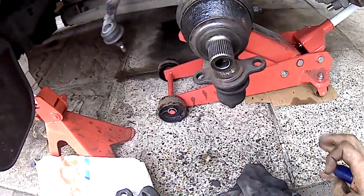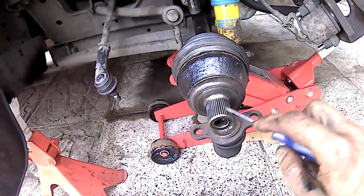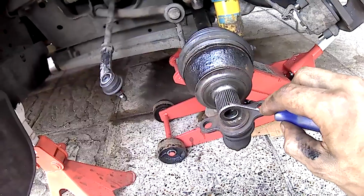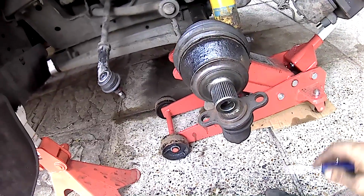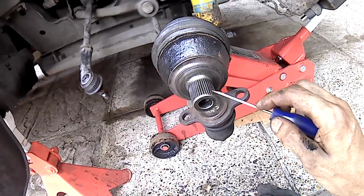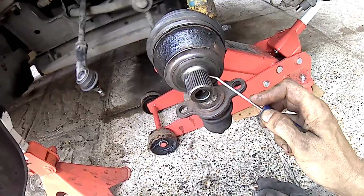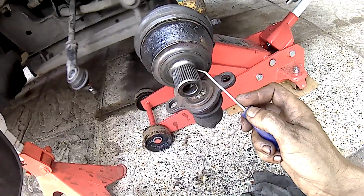So, the bearing might be knackered, or it might be alright. There's only one way to tell, and that is to get it all back together and give it a go. And if it's failed, then at least I know next time when I'm doing the bearing to always support the underside of the bearing as well, so it can't push all the way through when you're putting the brake disc mount back on into that centre of the bearing.